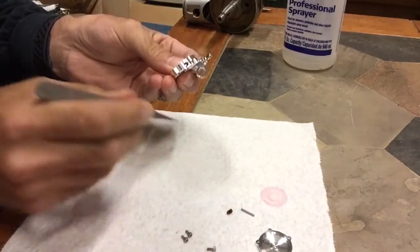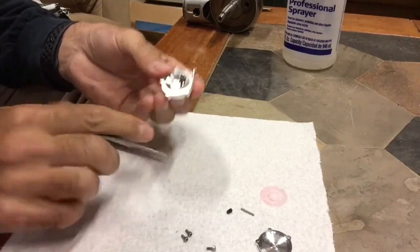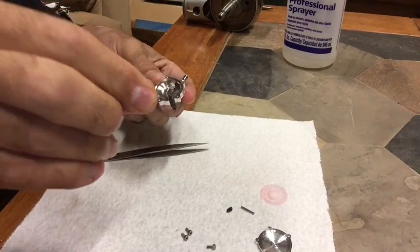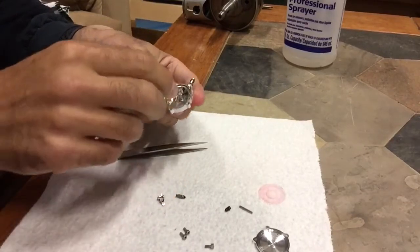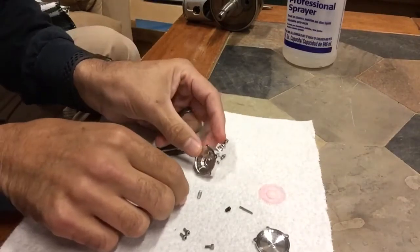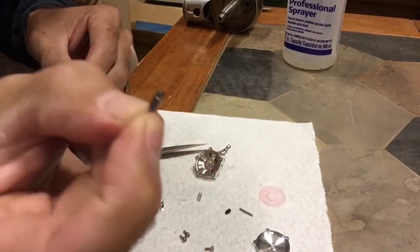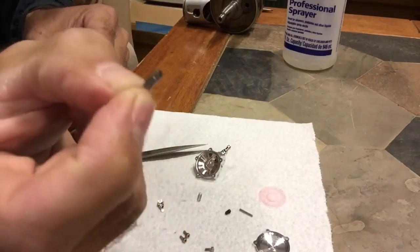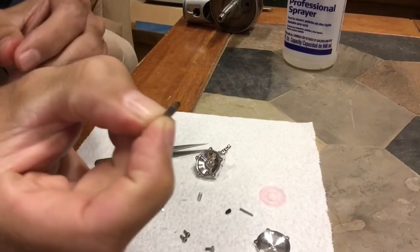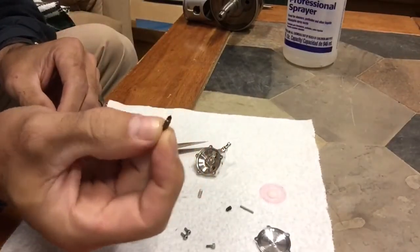There's the pin — a tiny little two millimeter pin. Now carefully release your thumb and you'll see the rocker assembly just like so. The small seat will come off the rocker assembly, and there's your small little spring. This is the part that usually gets clogged — it looks like a needle that sits in the bottom of a carburetor bowl, and the little tip is a rubber-type material. Sometimes stuff can get caught on that, so clean it off nice with your alcohol spray.